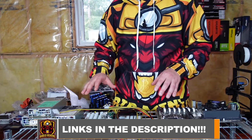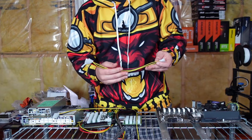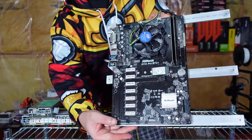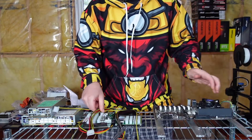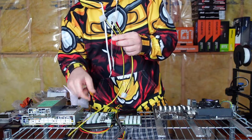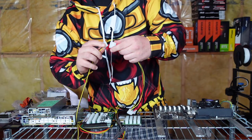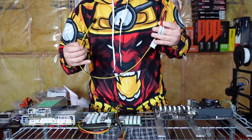Links for all items are in the description. Now here is our kit. We have a molex splitter because one of the main features of this motherboard is it has two molex ports for the PCI Express slots — one down here and another one up here. Both need to be powered. The molex splitter runs into a six-pin to single molex adapter. Stick these together — there is only one way they can go. Follow the flat end to the curved end and push them together.